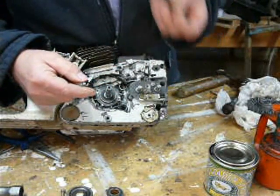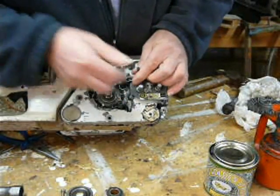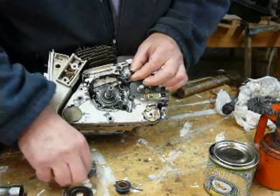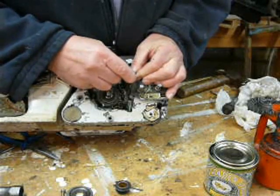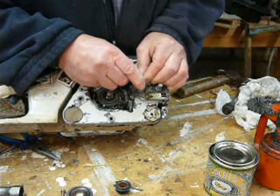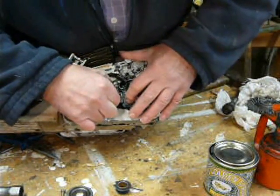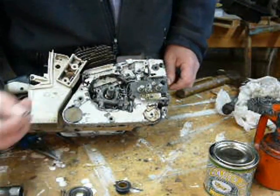This feed pipe — I've blown all that lot out so I know there's no muck in there. So that pops round there. The easiest way of course — there is a bit of muck in the end of that pipe — got rid of that. Is to fit that now. With all chainsaws it's a little bit fiddly, but there we go. Imagine trying to do that when the oil pump's bolted in place. So that goes down on there, and that suction is now located in that rubber.